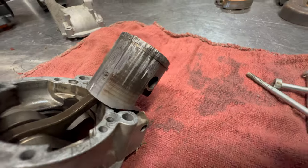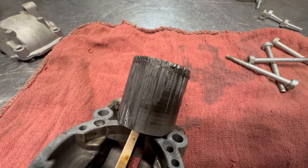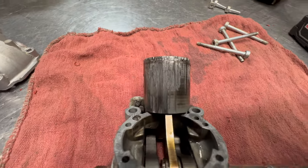I just did one of these the other day — I'll throw in a video here so you can see it. As you can see, this thing is completely impacted with that artificial turf, and what happened is this thing essentially just overheated and it took out the piston. You can see the piston damage from it just getting hot. This is a major problem with these things.